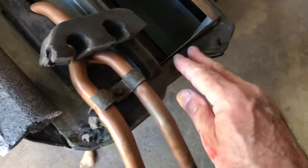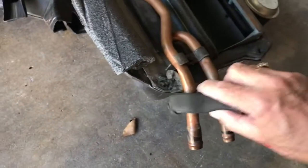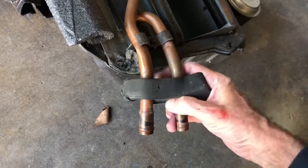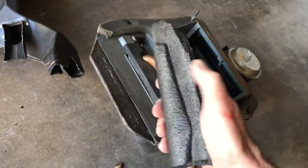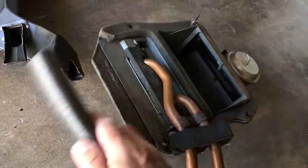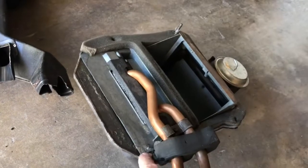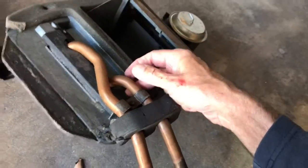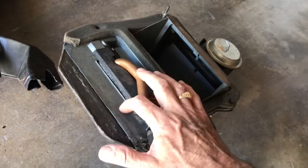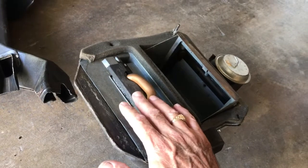The air handler — there she is, you troublemaker. The gaskets I mentioned were replaced back in 2014. It's got one gasket that fits around the tubes, helping differentiate between inside and outside. There should be a continuation of that gasket material through this area but it's obviously not there. A couple of bolts here — one here, maybe another one down here — and that will release the trap door that seals the heater core back in there.